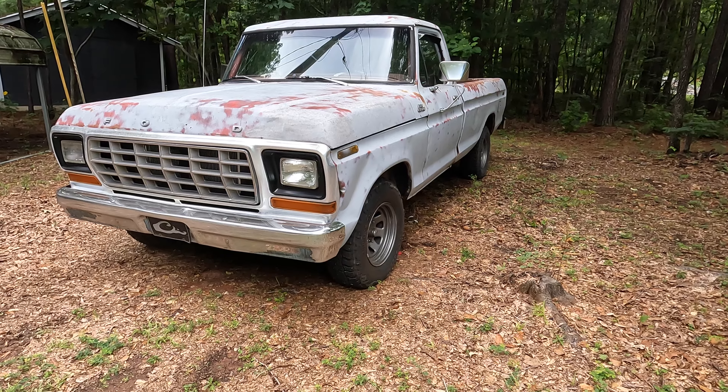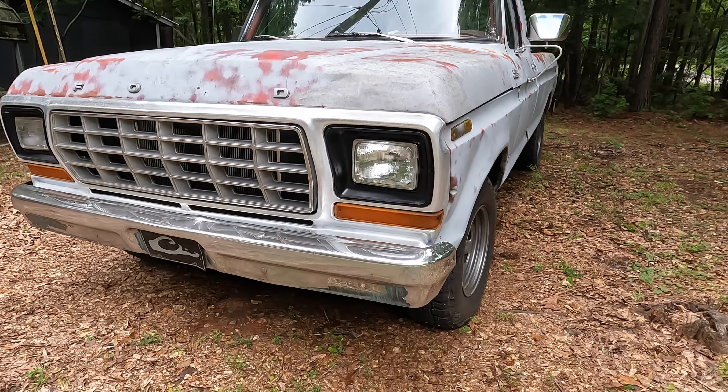With the right parts it took about five minutes to put back together. Did a test loop to the recycling center — about 10-15 miles — and the truck did real good, didn't overheat. It fires up perfect when cold and rides fine under load, but once fully up to temperature, if you let it idle it just runs real rough. I have one theory on what's causing it, but that'll be the next thing to dig into. Still some odds and ends to keep going on, but if you're enjoying the content make sure to like and subscribe — we'll have a lot more coming.